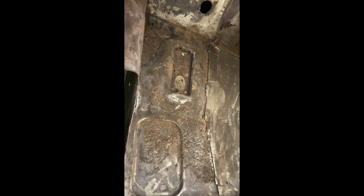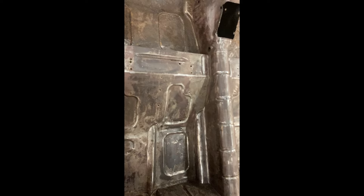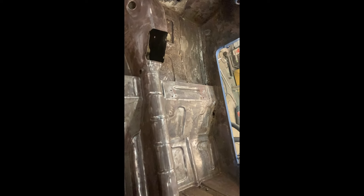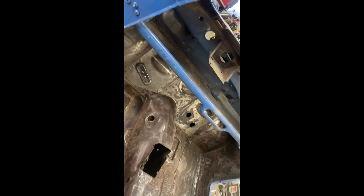I've got to make some aluminium plates to cover the holes where the brake cylinder used to be. For when it's a left-hand drive car, I'll make two identical ones, and then a little aluminium plate to cover where the pedals came through the floor since they'll no longer be there. There's a little bit of welding to do on some holes in this lower dash rail. I'll also put an aluminium plate over where the handbrake used to come through, so it'll all look nice and neat. Once the final rubbing down is done on the floor, I can spray it with the colour-coded stone chip and it'll really look smart.